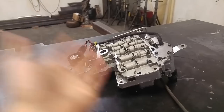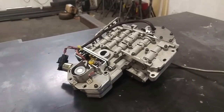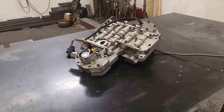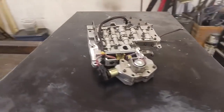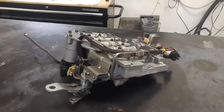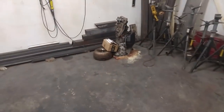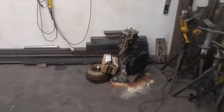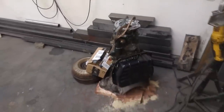Having the torque converter locked up is awesome actually, because the transmission doesn't make any heat if there's no slippage. So it's super good for cruising off road, or towing — if you're trying to climb a hill and you can't get all the speed you need. Ready to go. I'm sure this video is going to be super long already, so you'll just have to wait for my next video — I want to tear down the rest of it, replace all the clutches, check everything. So you better subscribe so you don't miss it.